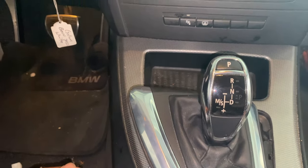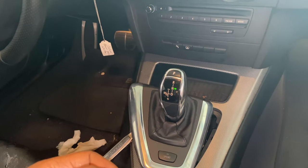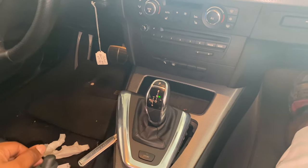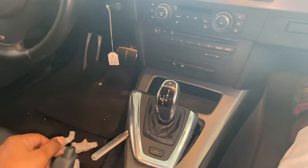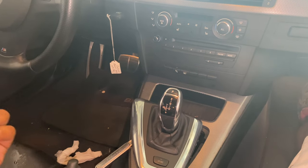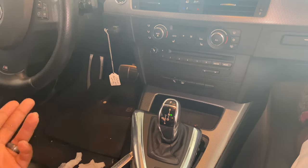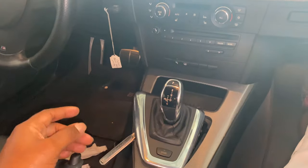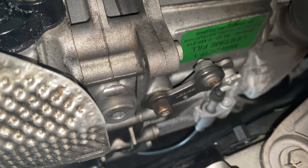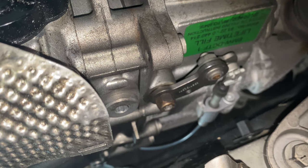What I'm going to do now is pull the negative wire and pretty much turn the whole car off to start the process of removing the engine. But if you were stuck trying to get on a tow truck bed, this is all you have to do. You could also go underneath the car, see that lever, pull it and it'll put it in neutral. So that's how it's supposed to look.